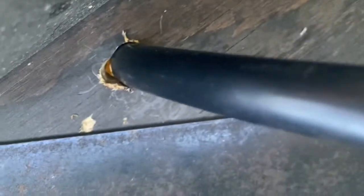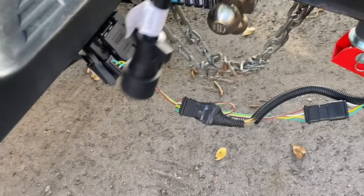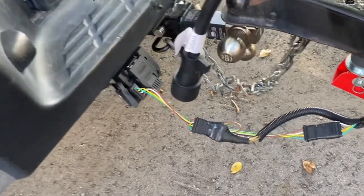This is the 7-pin — let's get started. These four wires that you're seeing here control his lights on the trailer, but he didn't want me to hook them up to the 7-pin, so I'll just do what he wants. I drilled the hole up underneath the trailer and took the wires out of the 7-pin box — this is a nice 7-pin setup, I really do like it. I passed it through to the inside and zip tied the wire to the chassis. Make sure you leave enough length so you can plug it in and your trailer can turn without any issues.